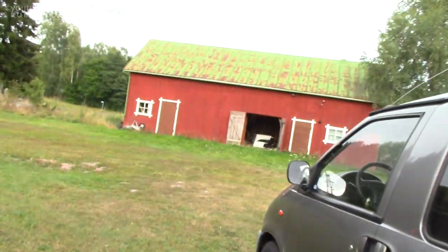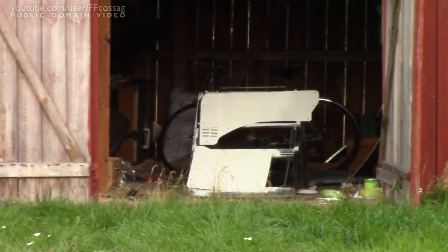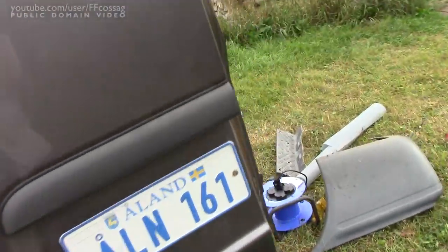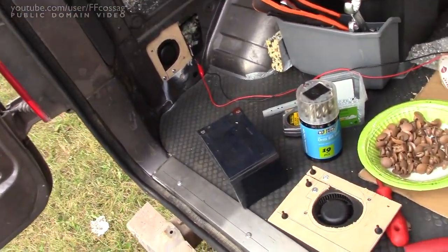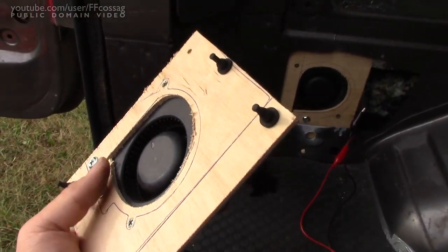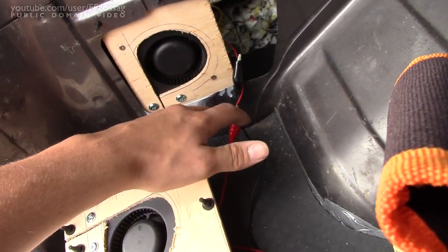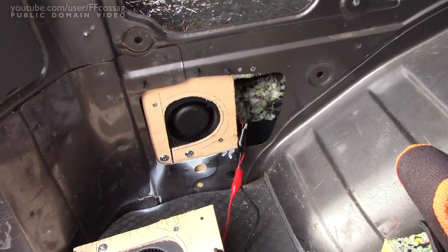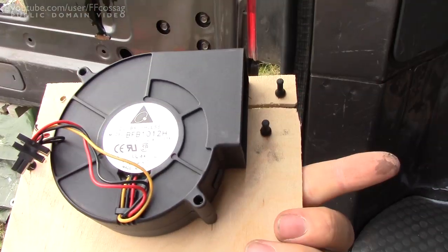Today I have been working on painting the internal panels of the van - all of them, just white, two coats, same as I did the ceiling. Works out pretty okay, although the cardboard doesn't absorb it quite as well as the plywood. And since that I've been working on ventilation. The fans I've chosen are centrifugal fans, because that gives me the right angle of the air straightaway - the holes are down there, so I want the air to be moving down and then out.